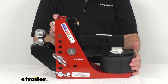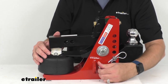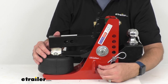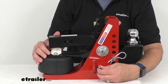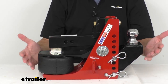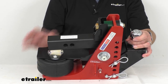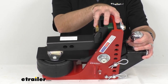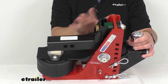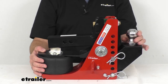The airbag is easily adjustable. For heavier loads, you simply add more air, and for lighter loads, you let the air out. There is a valve right here that makes adding or removing air very easy. To determine the correct amount of air to use, hook your trailer up and then load it the way you are going to tow it. Add air until these bump stops begin to compress — once they begin to compress, you should have the right amount of air in your airbag for your load and you are ready to go.